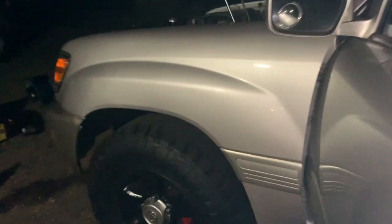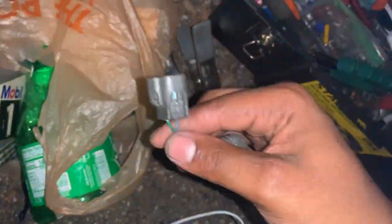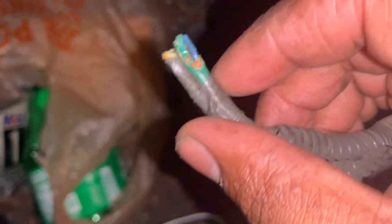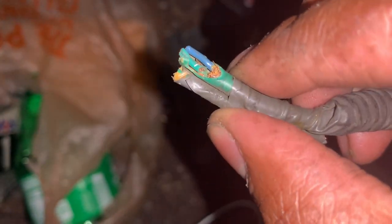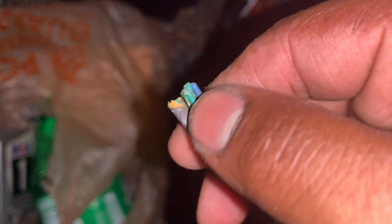Alright, so with that off I can now speak. Pretty much what the issue was is my crankshaft position sensor — the wiring was pretty much torn up. This is the crankshaft position sensor wire, and the issue was right here. That portion was nicked. The green wire is pretty much chewed up and the blue wire is nicked.